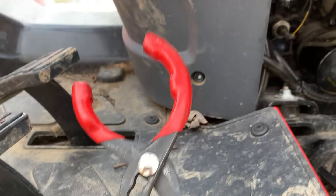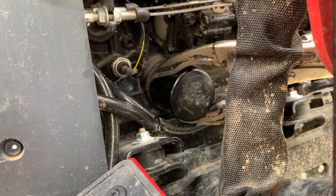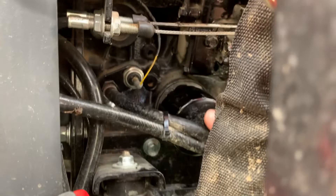You can't get a normal oil wrench onto it. So then you try this handy grabber thingy I bought, but it has failed me more so than Tony Stark's robot. So I went back to the oldie-but-goody long channel locks just to get it to clamp down and bust loose. And lo and behold, it turns. That's how you break it loose — make it simple. Once it gets going, just hand crank it.